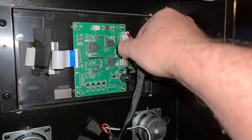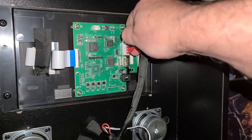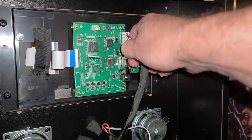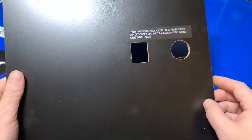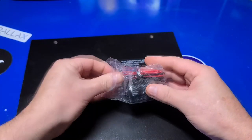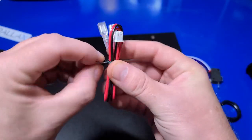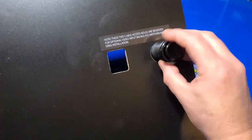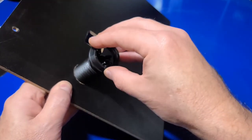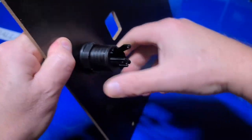Now take the LVDS connector with the exposed pins to the left and gently slide it into the connector. Make sure it's fully seated into the VIBS board. This is how the cables should look when done. Note that the small board to the right is no longer being used. Moving over to the workbench, we'll now prepare the back panel for installation. Take the switch assembly, remove the nut from the back of the switch and the wrap from the switch cable. Insert the switch from the side that has writing above the cutouts, then tighten the nut all the way to hold the switch into place. Be sure it is fully tight against the board.